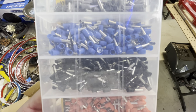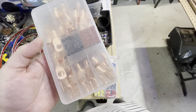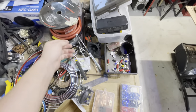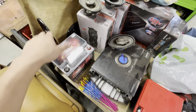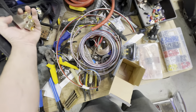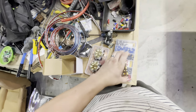These are the little clamps you use to get a more professional end on the wire — I'm going to use those for the speaker wires because I think that's the gauge that would work best. I do have these larger ones to connect some — they're copper crimps and they'll connect the power and ground wires. I have this here, and I am going to be putting this extra battery in there, so I'll have this battery and this isolator. I've been busy so I'm going through these and deciding which ones to use off the main battery.